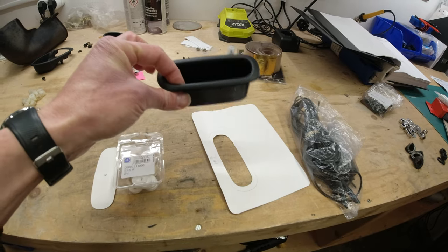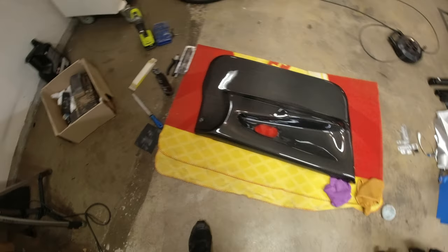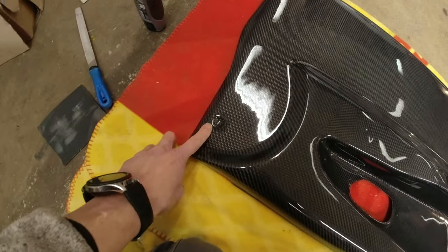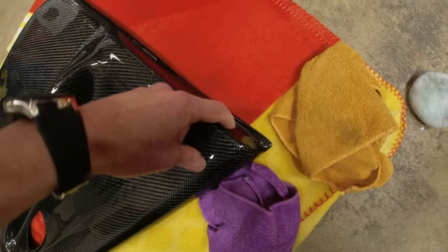The template has an in and an outside — the side marked 'in' goes to the inside of the car, and the other side goes to the door itself. We just need to start by making the two holes — the original OEM screw holes in the door card. When I was testing these originally, drilling those two holes straight on the car was no issue — awesome job Rallitech. Then we'll get the door card on the car and start cutting tentatively to find where the handle hole needs to be.